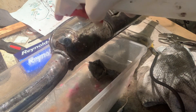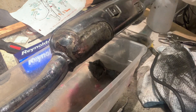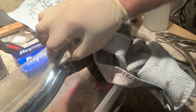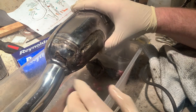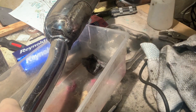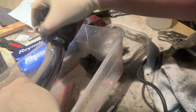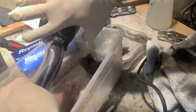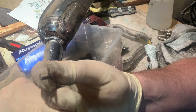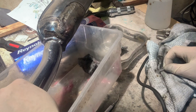Back at it. Let's knock the water off and clean this stuff off of here. It actually looks pretty good — I think that's probably about as good as I'm going to get this. I'm going to hit it a little bit more with the Dremel just to clean it up. I think what I'm going to do for a fix is go with high-heat VHT primer and then a little bit of VHT engine enamel. I'm going to spot hit this, clean it up really good one more time, and then we can paint it and move on. The further I go, the more rust there is, so I'm going to pump the brakes here and try to minimize damage.